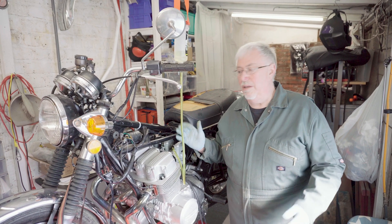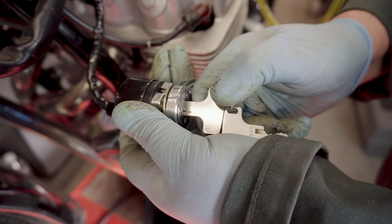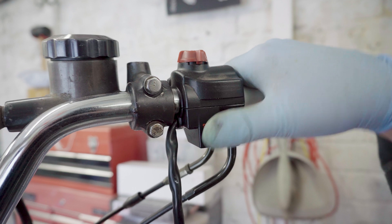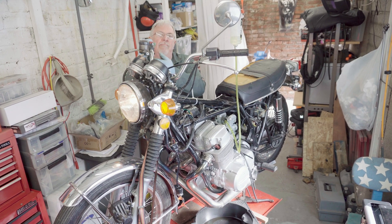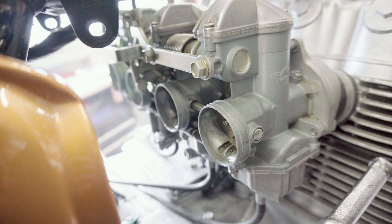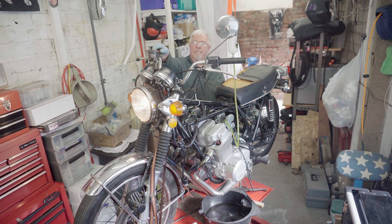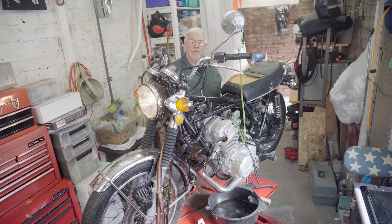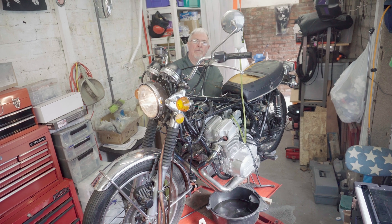It's not going to be a very long one, but I'm going to compression test it and leak down test it — but before that I'm going to start it. Famous last words, but it should be running on all four. It isn't running well but I'm not surprised with the carbs as they are. It is running and it seems to be running on all four. If you're worried about the smoke, I think that might be something to do with Coco's paint choice.